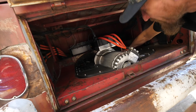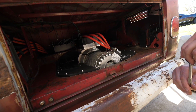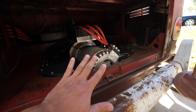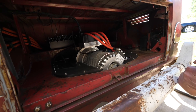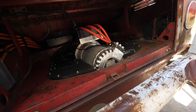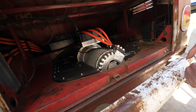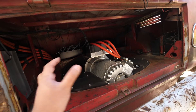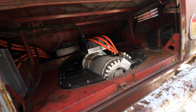Here's the thing about this Hyper 9 — the difference between this and my motor is that this is a permanent magnet motor. The technical name is permanent magnet synchronous reluctance AC. It's reluctant to be called a DC motor. The rotor has permanent magnets, whereas mine doesn't — mine induces the magnetic field into the rotor. This one already has magnetic fields. The result is it's a little noisier and it cogs — at lower RPMs there's a reluctance to move between each field.